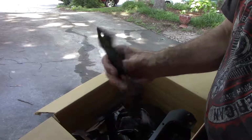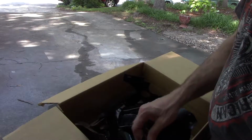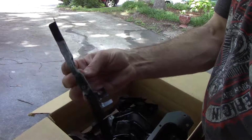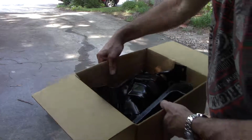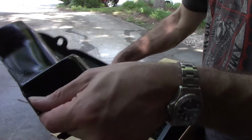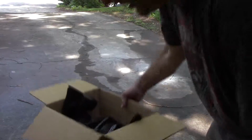It was kind of hogged up right there, and there was a hole for, I think, a smog tube to go through. Went ahead and welded that up on that one, and that one to help seal everything up a little better. And there were a couple little more places that needed tacked. Pretty much it for that part. This one, that whole flange was gone too, so I scabbed a piece of metal in there and welded that back. So that was all taken to bare metal.